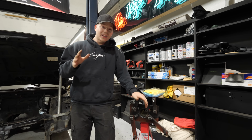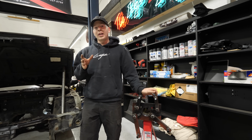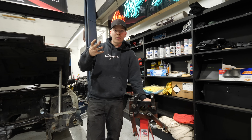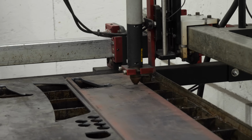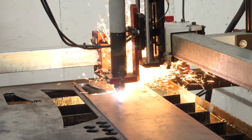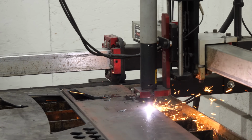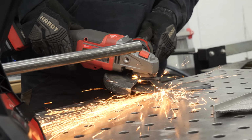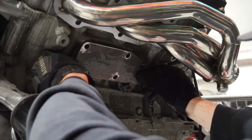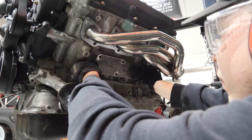Now before we can start making the motor mounts, because it's gonna be a two-part system that has to unbolt from the subframe and from the block, we have to make some plates that will bolt to the side of the 1UZ, and then we can build everything off of those plates. Put washers on the back of the other three areas. That's okay.